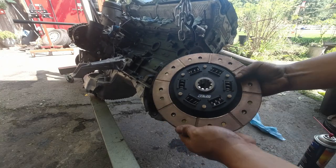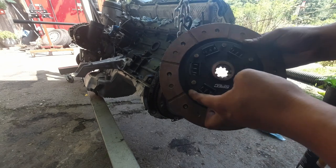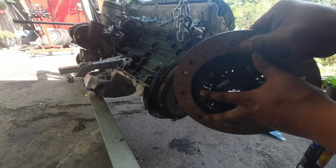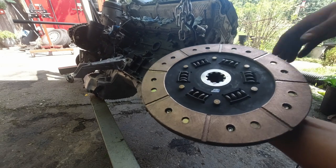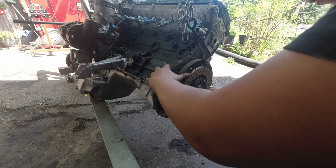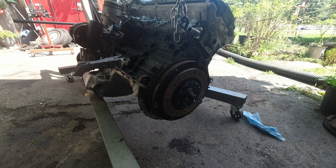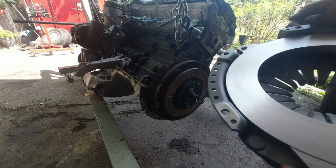Most clutches are going to have two sides to them. It's very important that you align this correctly because if you put this in backwards, some clutches will work but they'll sound terrible, other clutches will just not engage completely. Spec's pretty cool because they actually label it — as you can see, it says 'flywheel side,' so it's almost impossible to mess this up, but you really gotta pay attention to it. Once that's done, we can put on the pressure plate. Don't forget to clean the pressure plate because it is coated with anti-rust oil from the factory, so make sure you give it a quick brake clean.